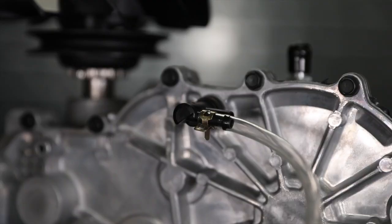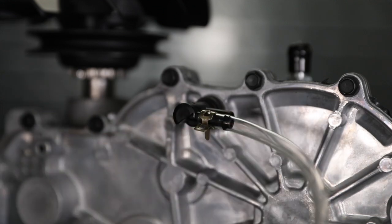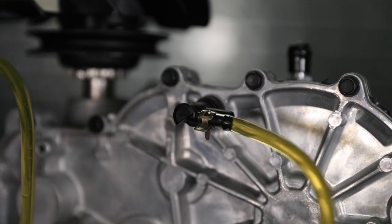On units with an external tank, remove the side port and fill through the external reservoir until reaching the bottom of the side port. Replace the plug and continue to fill to the cold fill line as recommended by the manufacturer of the mower.